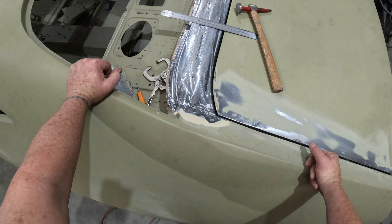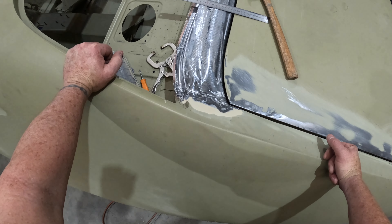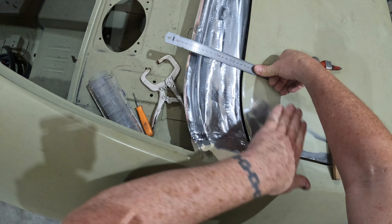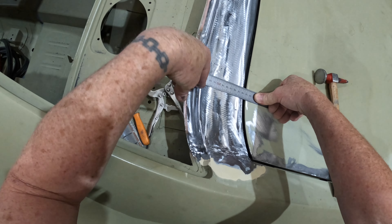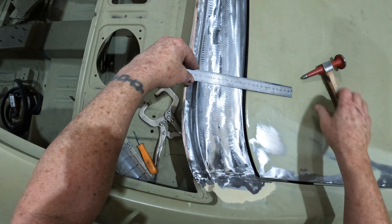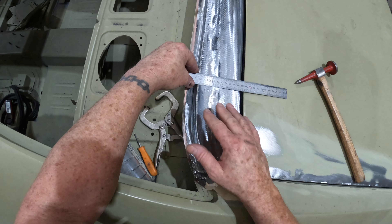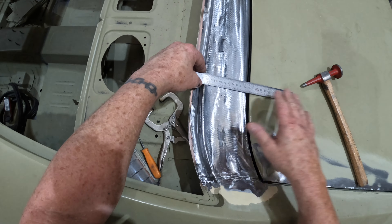What I'm going to do now is go along with this ruler and the pick hammer and just isolate any high spots which are going to be a problem later on when I do the filler and sanding. Having the arc of the ruler going through there, making this the highest spot. It's just full, and that's because I welded that 25mm section in there — with all the heat distortion and everything else it moved, and it looks like it's caused this part to kind of rise up a little bit.